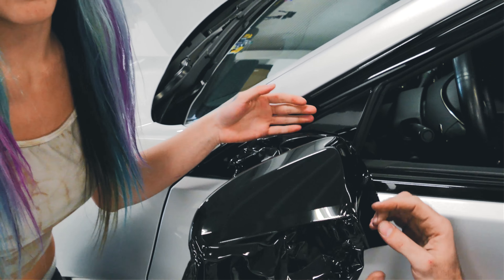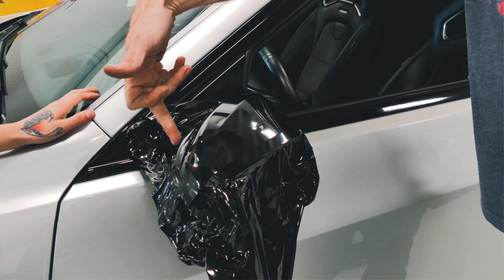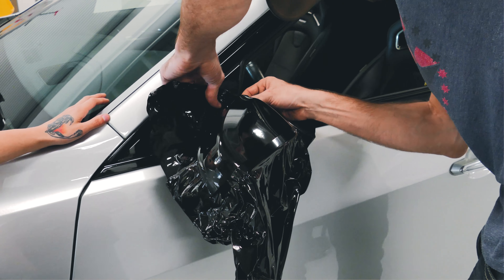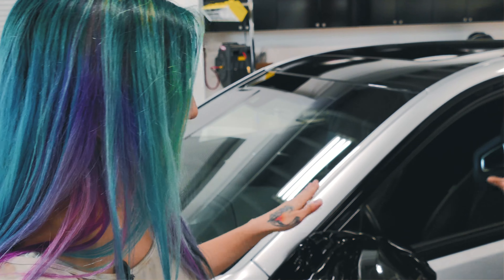We wrapped the majority of that, just blanketing the panel properly. Now that this is stretched, you can get most of the edges down. All these edges are going to be stretched, of course, but we're going to heat that up later — pull it up, heat it, and it'll shrink down and grab. It'll hold if you get the right stretch. You always want to, when you're in a pre-stretch, work down as much as you possibly can on the material. Then you want to lift up all the edges and heat it back. Once you heat it, it's going to shrink, and then you're going to deal with all the little wrinkles — what they call bottle caps on the edges. You don't want that because once this goes outside and sits in the sun, it's all going to pop back up and look bad if you didn't pre-stretch it right. So that's something that's super important.